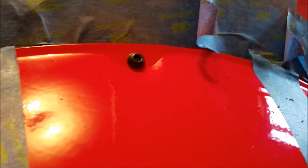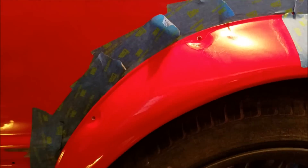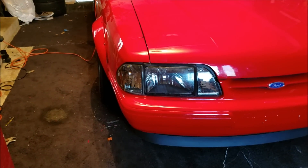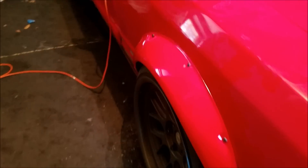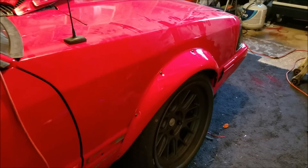I've got two of the bolts in so far. After I make each hole, I'm remounting the fender flare to make sure my drilling points line up — and they have shifted slightly, so one is a little bit off center. I want to double check each hole before I drill a new one so everything can be dead center. Make sure you double check your holes because once you drill it, you can't un-drill it. There's the semi-finished product — everything's bolted up. That's one fender done; now I get to do it four more times.